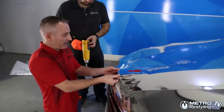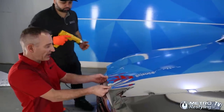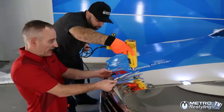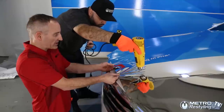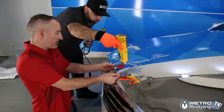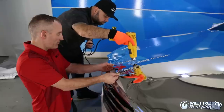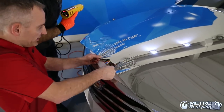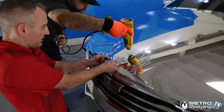I'm going to hold it tight at about 500 degrees. Close to the car, you see those fingers — they will disappear. We're going to break them down. With a constant motion like that you can throw a lot of heat on there; you don't want to direct the heat in one spot or you'll fade it. I'm going to split this in half, lock it here, and move my fingers there — lock that down. I'm not releasing the tension.